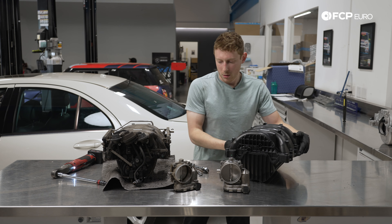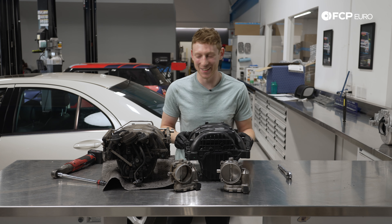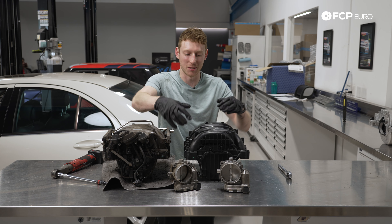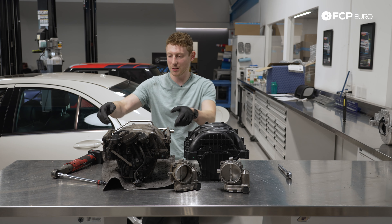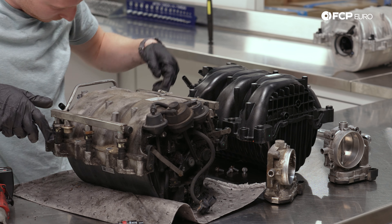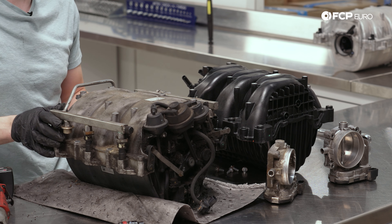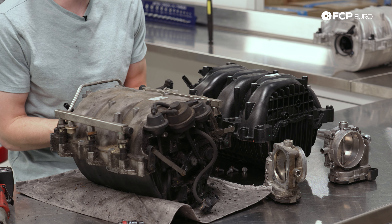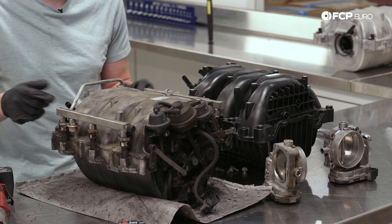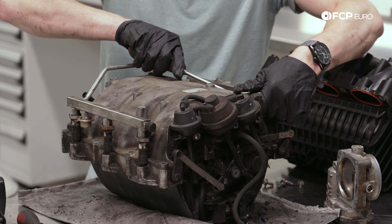I'm going to transfer the rail directly over. The easiest way to make sure you don't do it backwards — pretty hard to do on a standard manifold, and not that hard on this one either since there are no bladders — just line up the throttle bodies. Then gently coax it straight up; it may fight you a little depending on how long it's been there. If it fights you, take a flathead, stick it underneath the bolt holes where the rail bolted to the intake manifold, and just pop it upwards gently. Once it's out of that seated position, you can pull it up by hand.